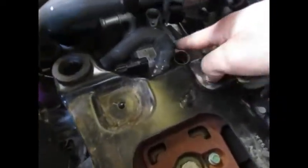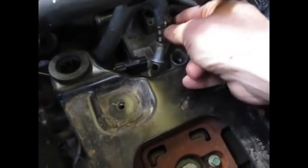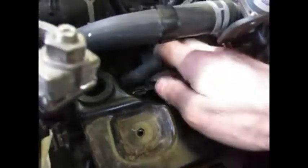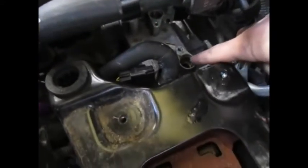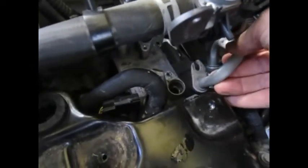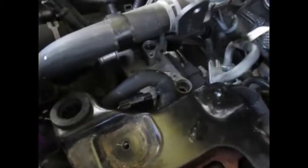Here is the cooler — the little cooler's right here. I've already taken off the hoses. This hose is the coolant hose and there's another one right there. These two openings are the transmission ports right here. There's a simple bolt that holds it down — it's really not hard. This is the part we need to replace.